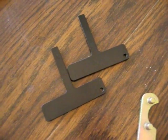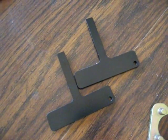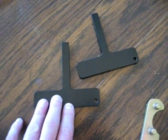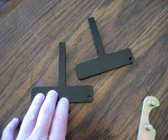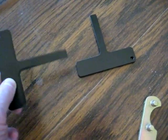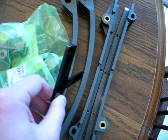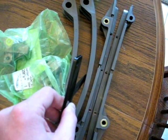Here are some of the tools required to change the tensioners and timing chains on a 98 Jaguar XJR. You need two tensioner shims. These go on the tensioners that tension the long chains — the chains between the camshaft and the crankshaft. You put these shims in to apply more pressure to the tensioners, to push them stronger against the chain before you tighten down your cam gear.